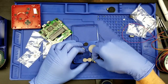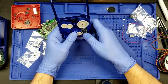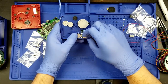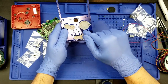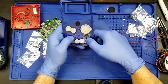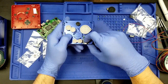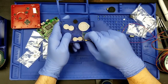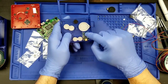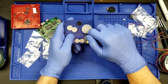All right, good. Thing is, I wish that this USB-C area was a little bit better fit for this particular board. I mean, I get it. There's different types of boards that one could use. This is just the one that's being sold on Boxy's website, along with the 3.5mm jack. It's just that if you're going to be selling one on your website that's fitting this, it's probably a good idea to make sure that, like, absolutely sure that it actually completely fits snugly in the recess that's meant for it. Because as it stands, if I want to get this port aligned properly with this, I'm still going to need tape here, because these edges on here aren't enough to keep it centered and in place. Like, it moves around in there. The tolerances are awful on the spacing with this.